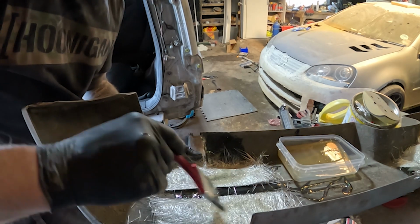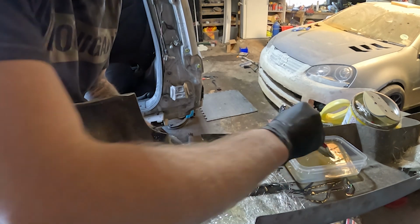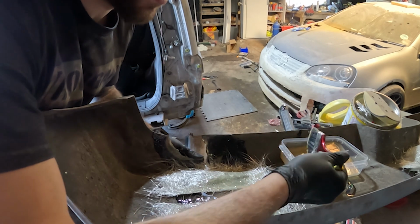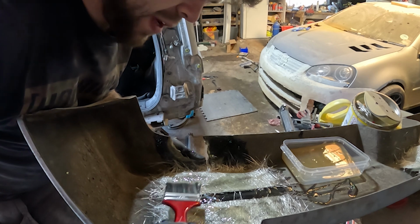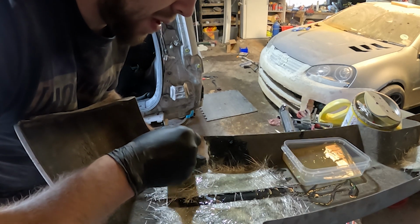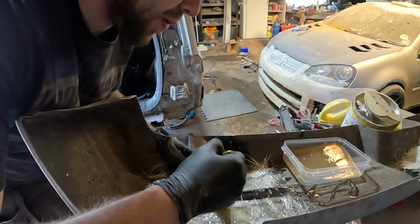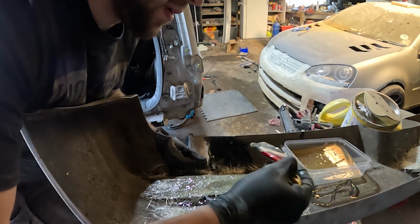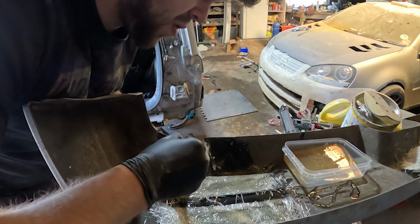So yep, we'll just go over the top of the fiberglass now with the resin. Make sure it's fully soaked. There's no real rule to how much to put on, because the fiberglass will only absorb, that was a pen. The fiberglass will only absorb what it needs to. It can't keep absorbing. So whatever resin is left over, if it looks a little wet, I'm obviously gonna put more layers on anyway, because I need this to be reinforced properly. And I'm probably gonna end up doing 4 layers, maybe 5 layers, because I want this absolutely solid and to never come off again.